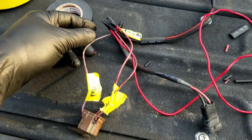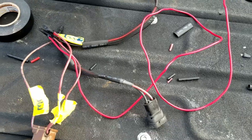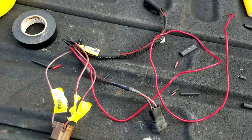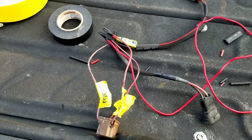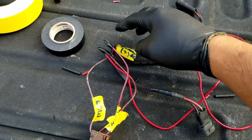So I bridge the low to the low positive and the high to the high positive on another plug. Then all of the grounds coming off here — the black wires from each connection and the ground off the H4 — I had those all merged together into one, and those will all be grounded together.